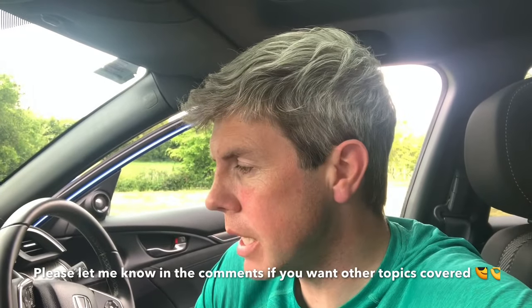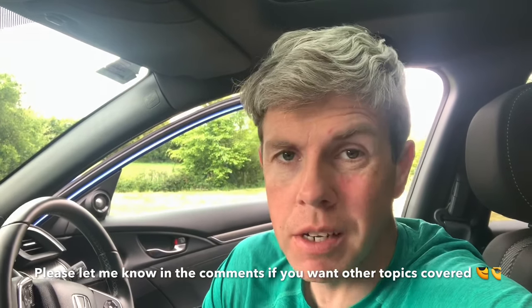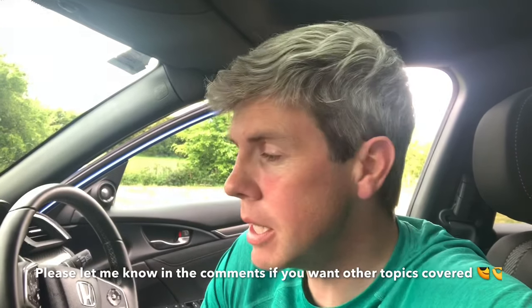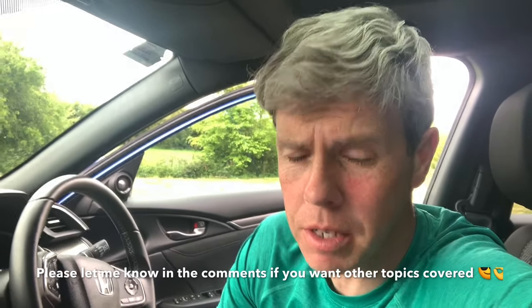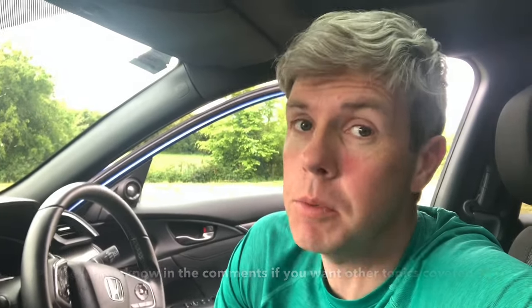Hopefully that's going to be useful to somebody. If you get any anomalies on the radio that come about and then disappear and aren't very frequent, just do a factory data reset. Or if something's not working, try a data reset first because a lot of the time it'll actually sort out the problem. Brian here at Fitzpatrick's — anything else you want to know about these radios or Honda cars in general, let me know in the comments below. If you think the video is useful, like and subscribe — thanks for watching.